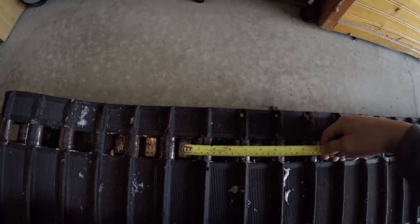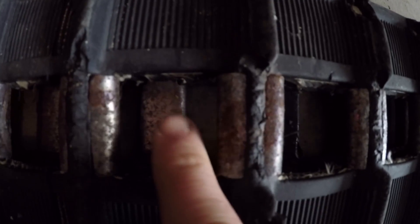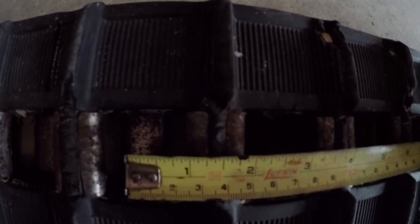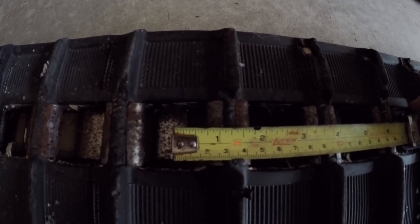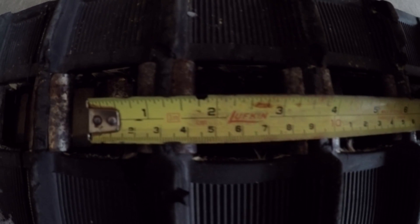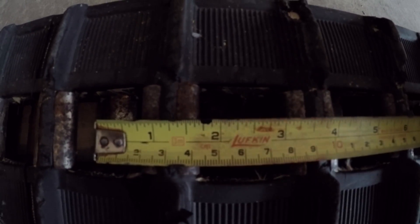What is pitch? Pitch has to do with the drivers — it's the distance between the driver windows, the distance between clips. It can be 2.86, it can be 2.52, or it can be 3.00. Those are the common track pitches. Let me show you exactly what that is. The pitch is the distance between the center of each of your driver windows. You can see the center here and the center here — we are going to measure the distance between those two. The center of this window ends up to be about two and a half inches, which is a 2.52-pitch track.